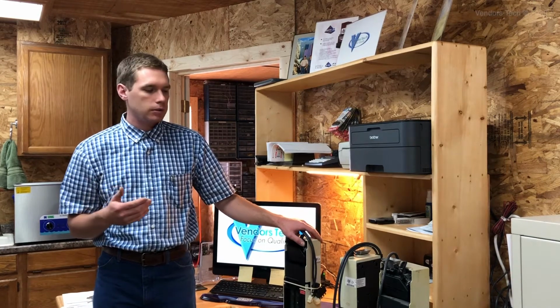Models underneath those that would work in any single price machine are the 3340, the 3341. These are all -S for Coinco models. The 9340, the 9360, the 9370, there's the 9341. All those models are single price models and are going to be a much better alternative if you're not going to upgrade to MDB to replace the TRC 6800H, which is MEI's single price coin mech.